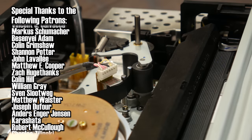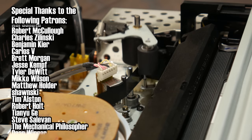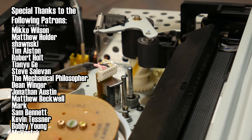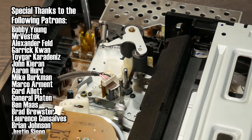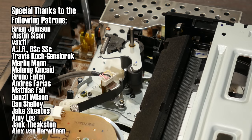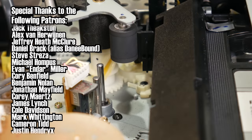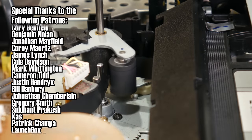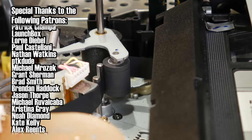In a similar vein, it's worth noting that not all VHS machines, or indeed Beta machines, would put all the components in the same places. Some VHS machines used this rather odd arrangement whereby the pinch roller would be lifted up and out of the way so that the capstan could be placed in front of the cassette. I have no idea why this arrangement was used, as it seems like it offers no practical advantage and also comes with increased mechanical complexity, but it serves as an example of the fact that just because the standard of the format never changed doesn't mean those specifications weren't achieved in weird and wacky ways.